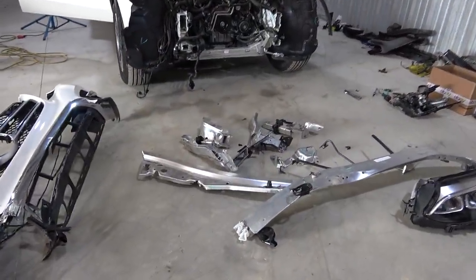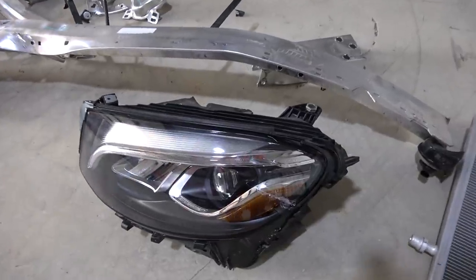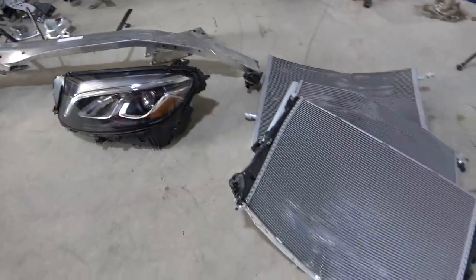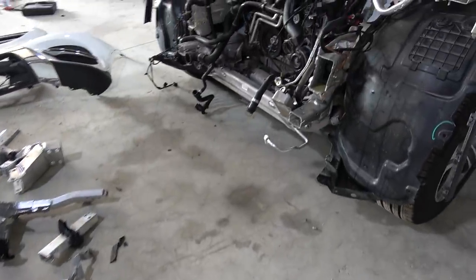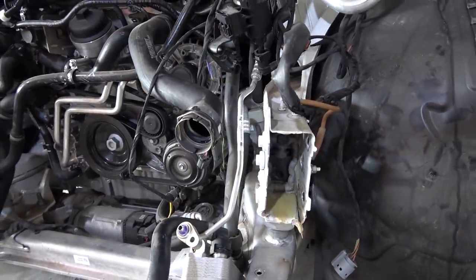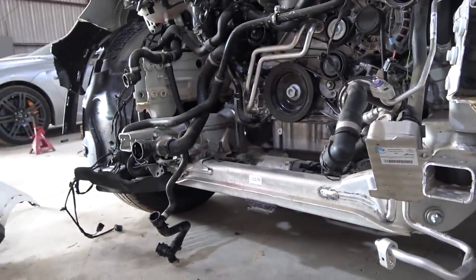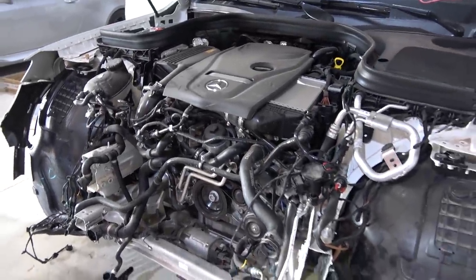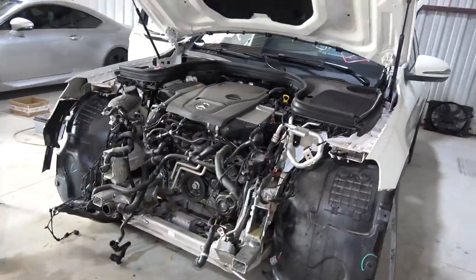The front end is torn apart — got a whole bunch of messed up metal here. The aluminum is all destroyed. The headlight I'm probably going to end up getting a new one because it has a whole bunch of deep gouges and two broken tabs. All three radiators are destroyed and I actually ordered three new ones — they're on the way. The front left rail is bent; this is the reason the insurance company totaled it out. It's pushed to the left and twisted up. The subframe underneath is aluminum but is intact — no cracks, no tears. I contacted Metal Mike and he said bring it on over.